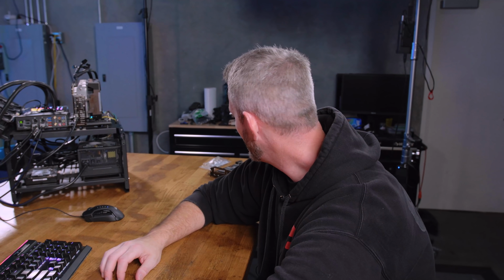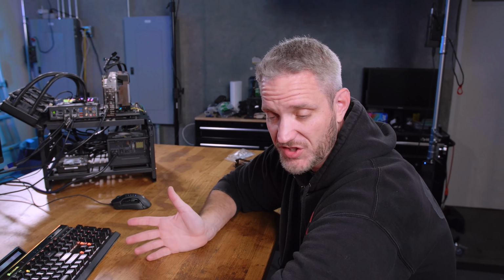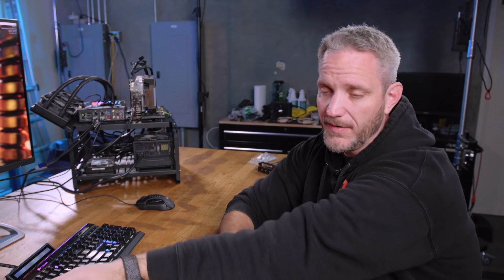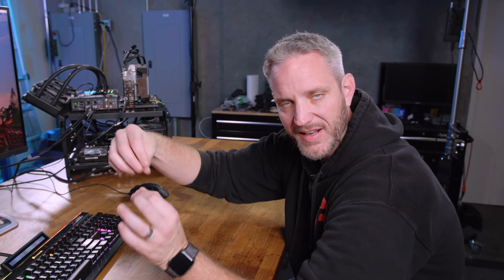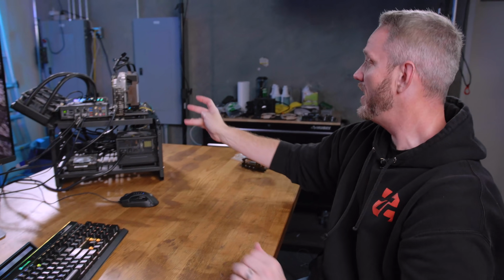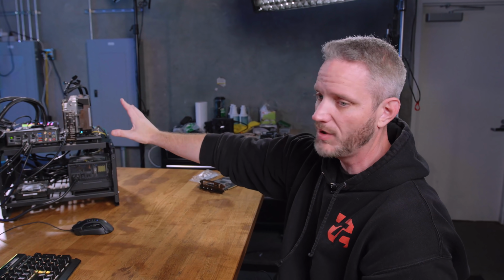The crazy thing about this though is at the very least we showed you could, if you wanted, change the fans to the black Noctua fans. The only difference is the fan's cable lengths are exactly measured and cut to fit into the little adapter that's in the shroud. But it's a 4-pin PWM adapter on there, and you could run any standard 12 volt fan. You could just zip tie up the cables out of the way and plug them into that header, and you could change them to the black Noctua fans if you wanted, which in my opinion, looks way better than the Noctua brown tan.